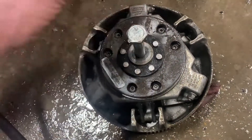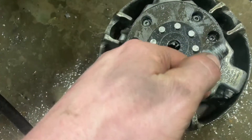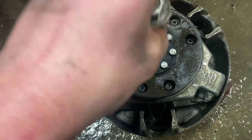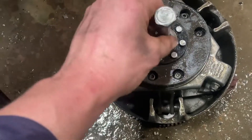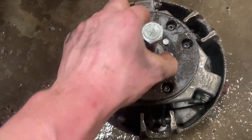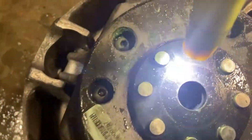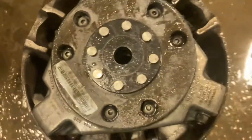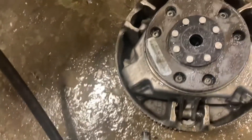That's what I ended up doing, and I want to tell everybody: if you're going to do this, put so much thread tape on — I put it on thicker towards the back so the front threads would still start — put it on until it will just fit through there. If you can't get it off and you're having problems like I was tonight, just squirt gear lube up into the top of the first threads in the clutch where the puller would engage, right up into those threads, and put an impact on it, say a prayer, and hit her as hard as you can. It should pop off.